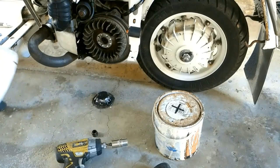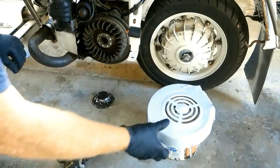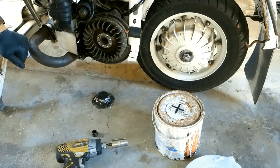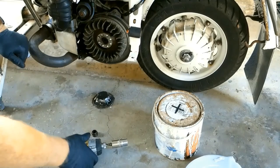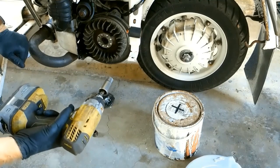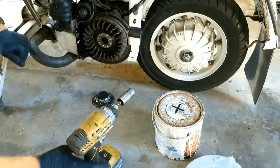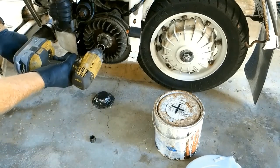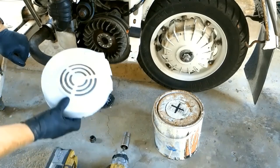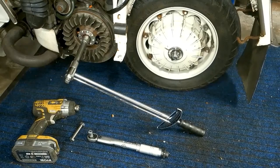Flywheel cowling plan B was to put it over this old tin of paint and give it another hammering. But working on the other scooter, I'd reached the point where I wanted to check the timing and the starter plate, and holding tools and impact wrenches started to get a mention. So I gave the flywheel nut on the other scooter a rattle — came off, no problems. Then I put it on reverse and gave this one a rattle, and it seems to have tightened up a couple more threads. I've had this on, fixed all around — the screeching's gone.